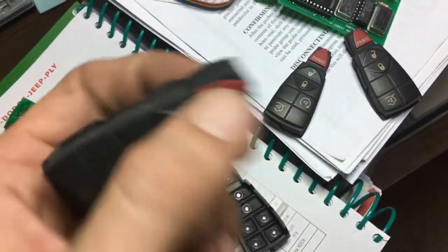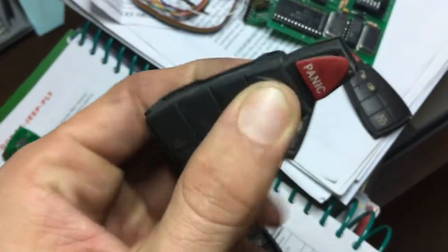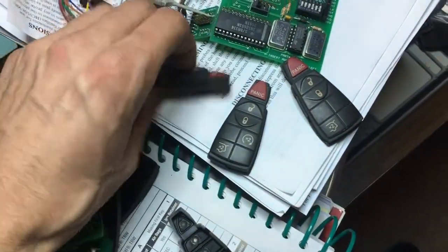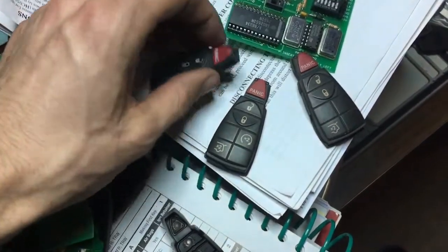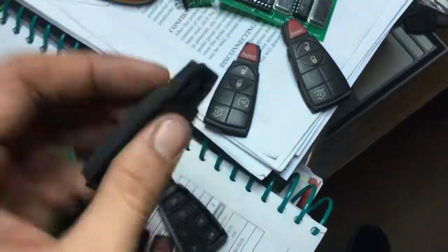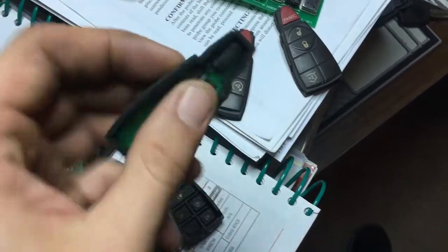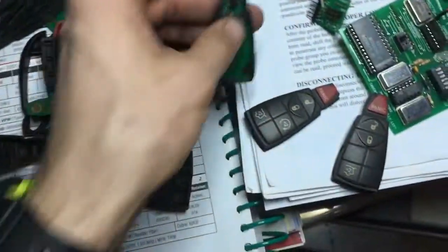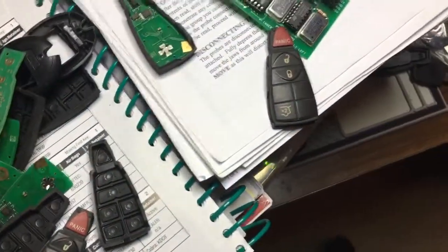Okay, listen. It's tactile. It's not tactile anywhere else that there's not a logo or a marked button, because the button pad has little pieces of metal stuck to it, and those can come loose. If ever you have a FOBIK that doesn't have a working button, one of those metal contacts is probably ruined. Okay, so we're building a RAM truck remote.